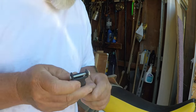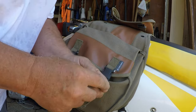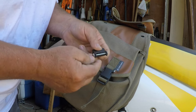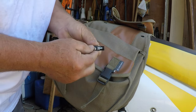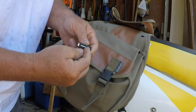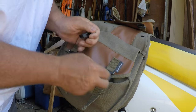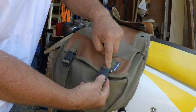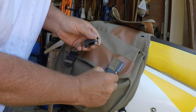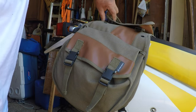I also carry extra clips. This is the clip that I made. On here you can see a little bolt. To make this, it used to have a little plastic bar that went across there. I cut that out and drilled two holes and just put the bolt through. I actually put a little piece of fuel line across in the middle to cover the thread so it wouldn't damage anything. On the nut I just put a little Loctite on it so it wouldn't fall off. They've stayed on ever since — they work good.